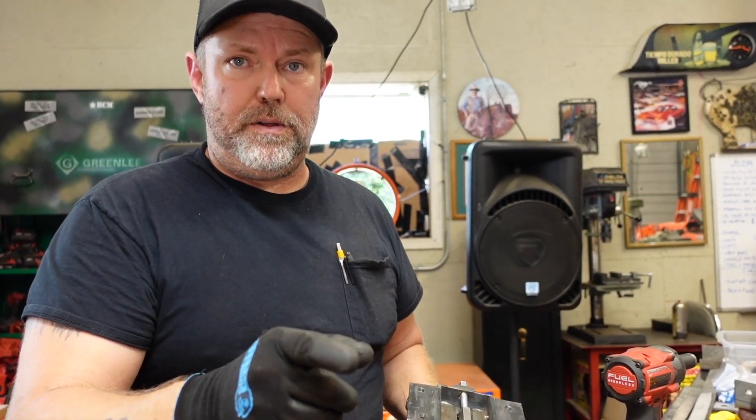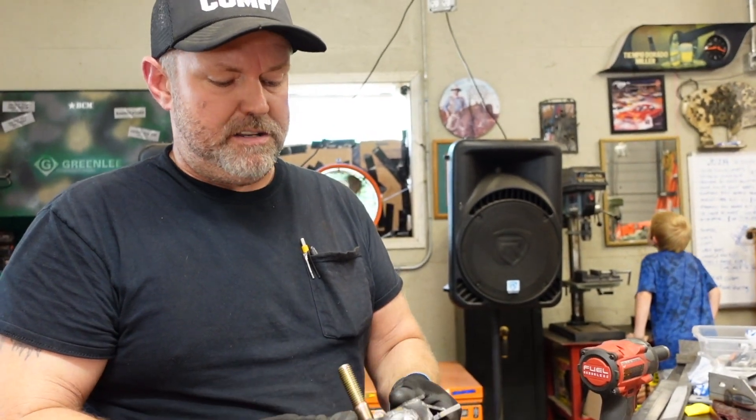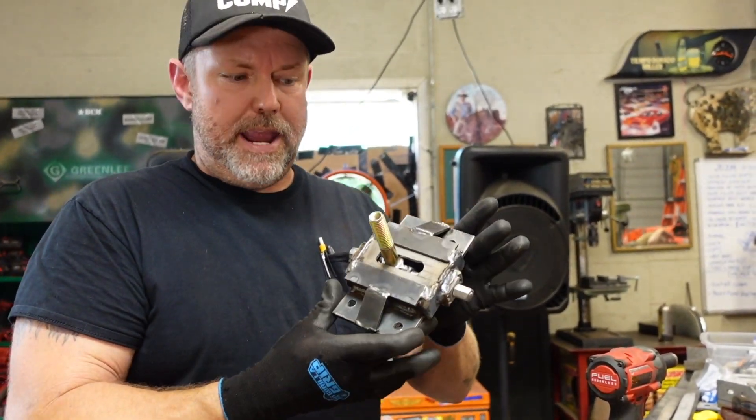It's a 93-inch belt. A 92-inch belt is too small, a 94-inch belt is obviously way too big. 93 is the belt that I need - the belt that I've designed this thing around - and I just needed to take up a little bit more slack out of it so that the tension spring arm will ride on the spring and not come into contact with anything, regardless of how much the belt breaks in.